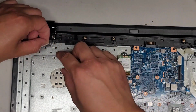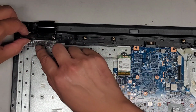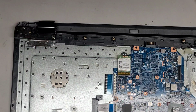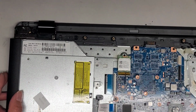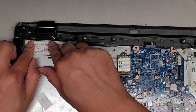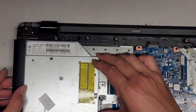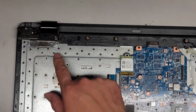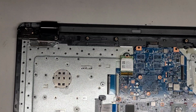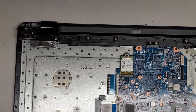Okay, same thing. And we have to be careful because the CD drive might actually stick to this when we go to install it. So let me show you. I'm gonna go to put this in. You can see the CD drive is kind of going on top of it. So I'm gonna actually put the CD drive in and then smash it down here. Okay, to get it to kind of fit properly. Then we can go ahead and take this back out. And you can see how it would smash all the epoxy out into that shape. All right. So when I go to install the CD drive, I have to be careful because I don't want it to catch on there and then drag it out.